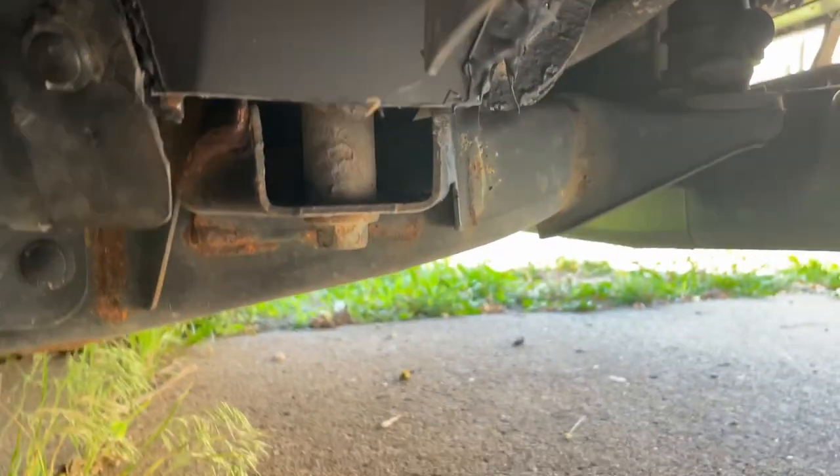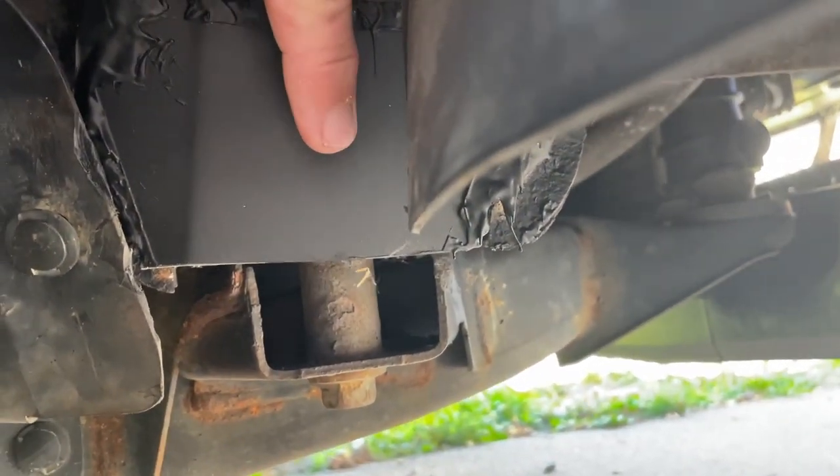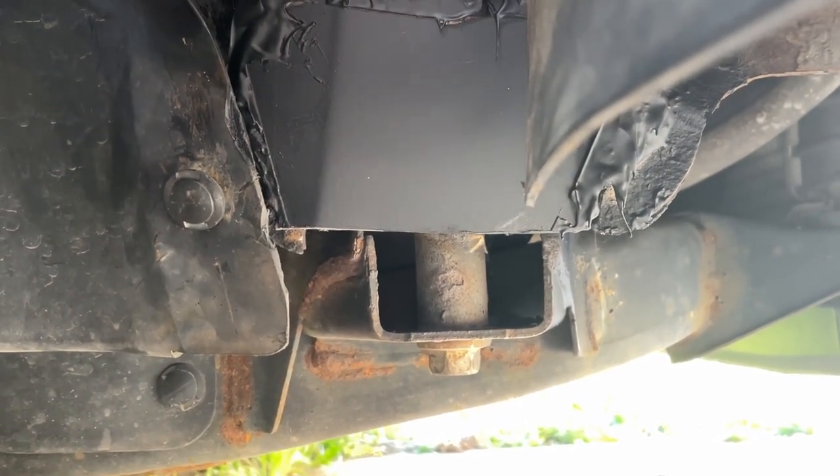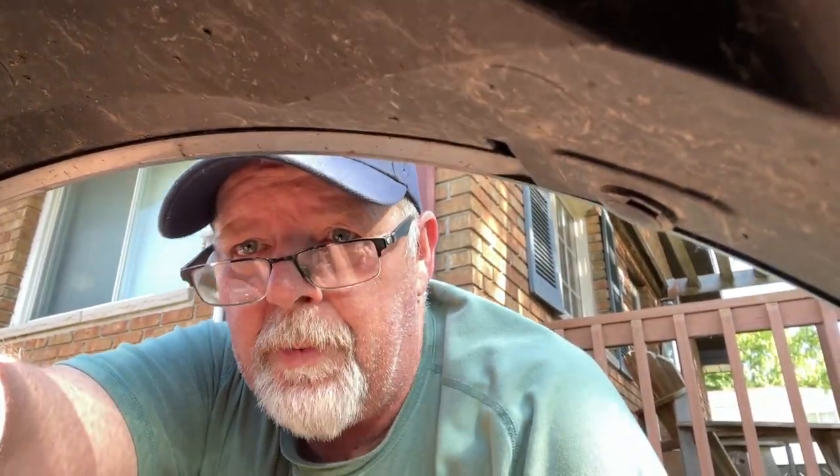Here's the end result. That's our motor mount right there, this is our new piece that we welded in, and we have our inner piece on the inside. I did have a couple of pinholes in here because the metal was thin in some spots — I just took some JB Weld and filled those holes in, because the welder was just going to blast its way through there. Anyway, that's the easy way to fix your frame if it's not rotted out too bad. There's a guy on YouTube who makes the full buckets for these — search him up if you need a whole replacement. But if it's just a small hole, it's easy to fix. Hope you all enjoyed that.